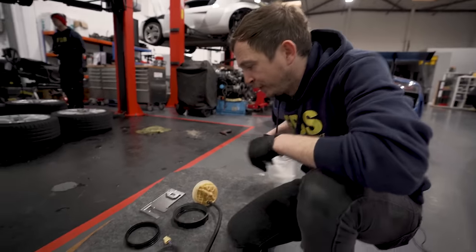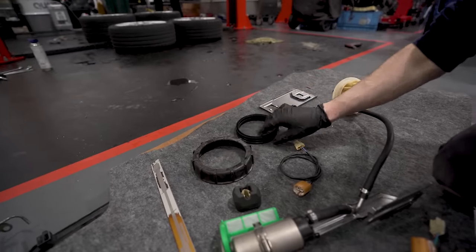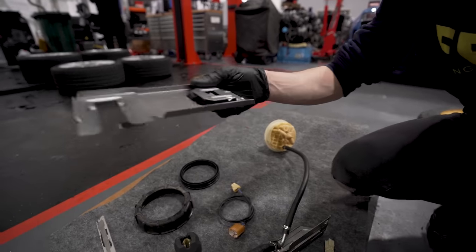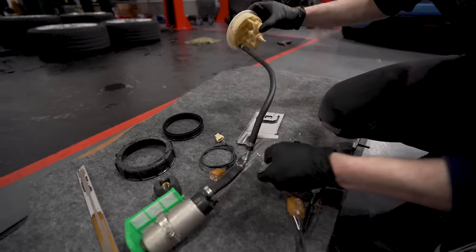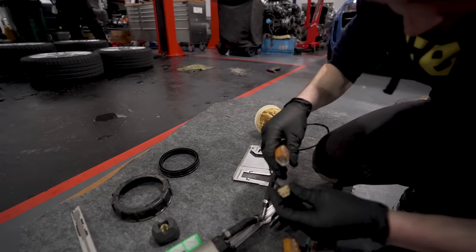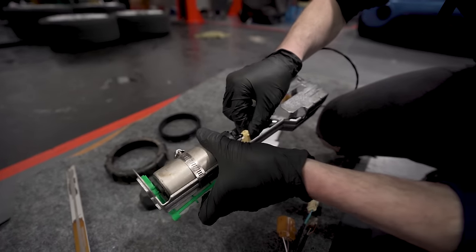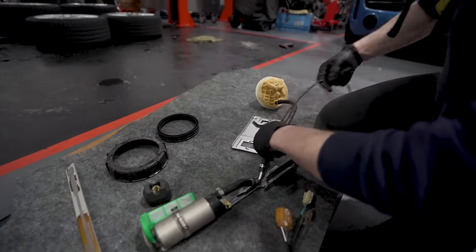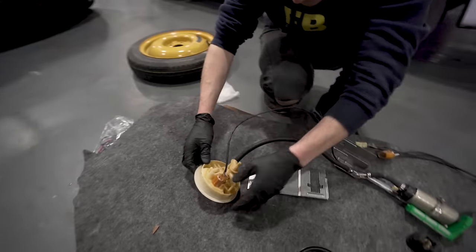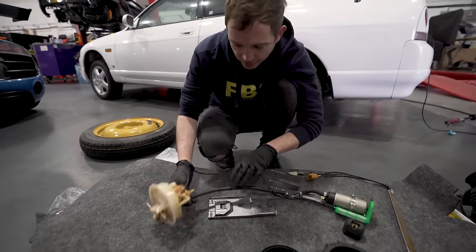What have we got then? So that's my fuel tank bit. A brand new seal, which was 60 quid, and the top cap, I'll give that a wash off. The two brackets, which in the last videos we redid. That bracket holds the level sender on. There's my fuel pump. So literally what we'll do is connect the batteries. Fuel pump goes in there, and then it goes up to that connector like so. There's one inside the fuel tank that I've got to do, but essentially that's that.